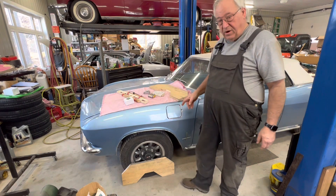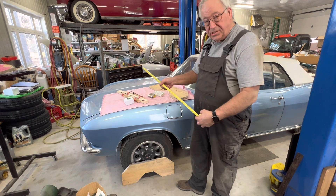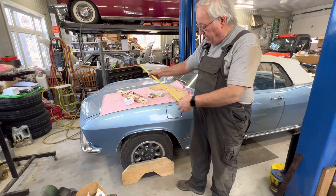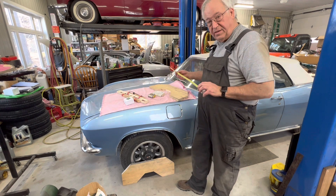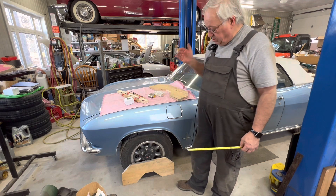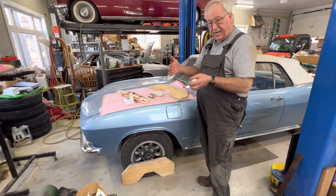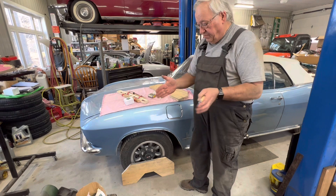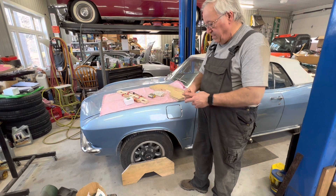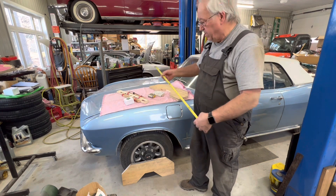As a backup after I'm done, the last step is to go across the tires — measuring the same ridge on the left tire and the right tire — on the front and on the back and compare the measurements. Make sure, depending on the cut of your tires, you can catch the tape measure. Mine are straight cut, so it's dead easy. Hook it on the last groove on one side and measure to the last groove on the other side.